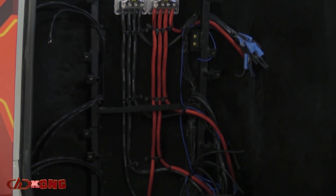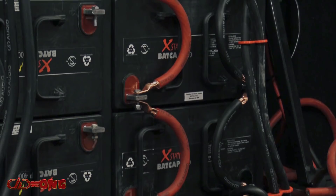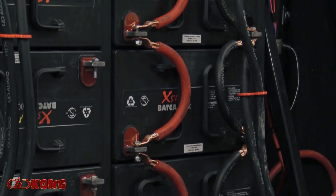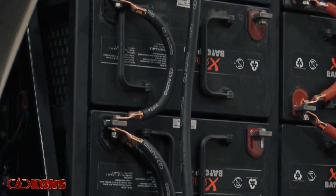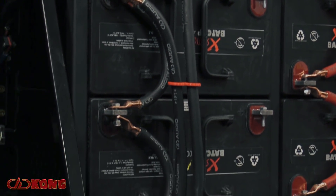We split them there and doled out power individually. For the battery rack, we turned again to our friend Mason and had him fabricate a rack system that allowed us to mount all the batteries vertically. We needed them to take up as little space as possible. With them being sealed AGMs, we were lucky enough to mount them in any orientation needed to fit the available space, so a vertical rack suited that need.